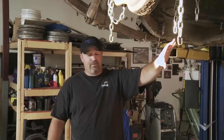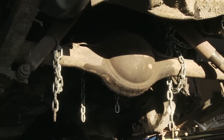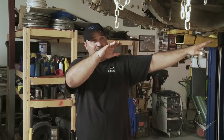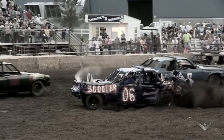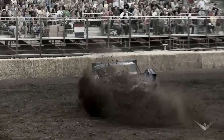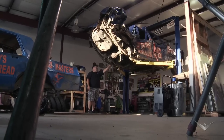We also tip our pinion. We remove the crossmember mount, which drops the transmission right onto the crossmember. That keeps the center of gravity of the drive line a lot lower so when your car bellies, it doesn't pinch the drive line and break it. That's how I was able to keep this car going even though my whole belly was dragging the ground. I think we're ready to go out in Logan.